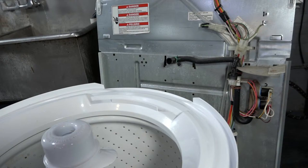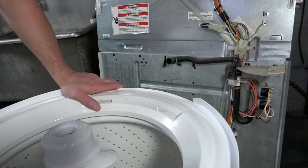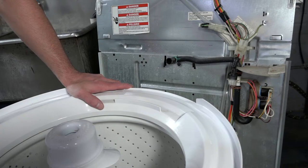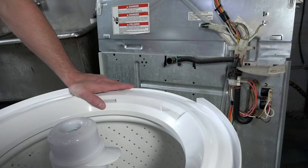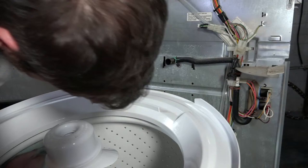One other thing I do is because the wire is just kind of dangling there, I'll always tape the wire to the tub. Because last time I did one of these, I sold it to a customer, and they called me a week later, and they're like, "This thing's making a real racket noise when it's spinning." And I'm like, "That's impossible." And I guess this guy put something wildly off balance, and it caused that wire to make a slapping noise. It was terrible. It was a long drive too. It was a long drive for a piece of tape, that's for sure.